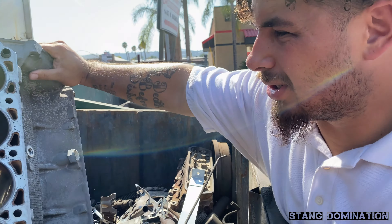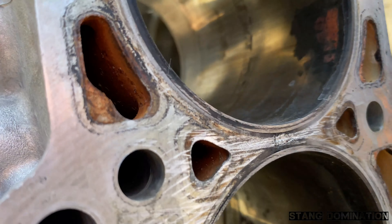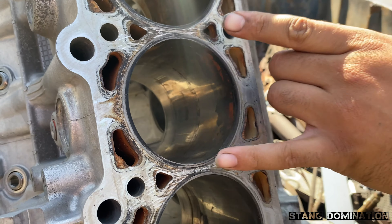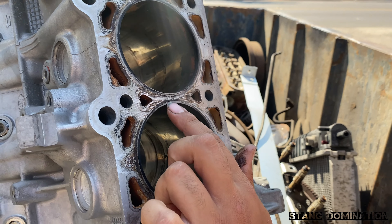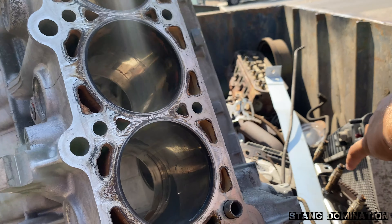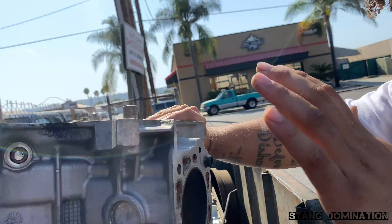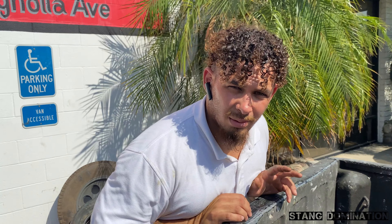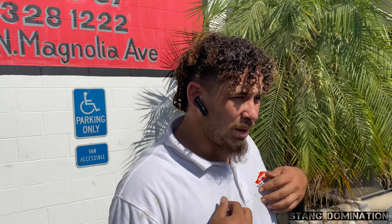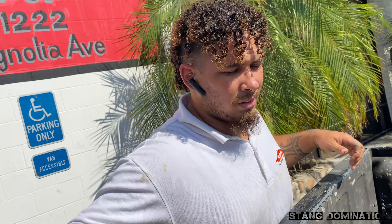As you can see it's in the recycling bin. The reason why it's trash is because the actual aluminum started melting — you could feel it with your nail. In these two cylinder walls the aluminum actually started melting down and the sleeves started going away from it. That's why he said this is trash. So we dropped the new one off — thanks to Isaac, aka cameraman right now, looking out. That's the reason why we're going with a different block.